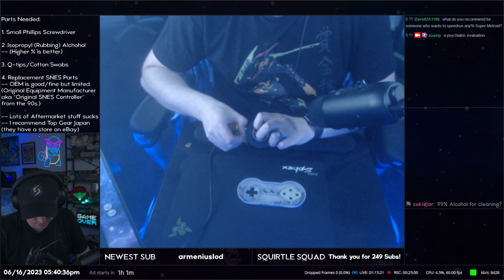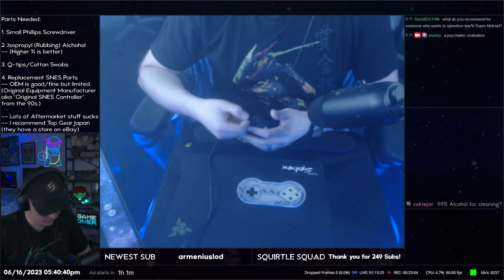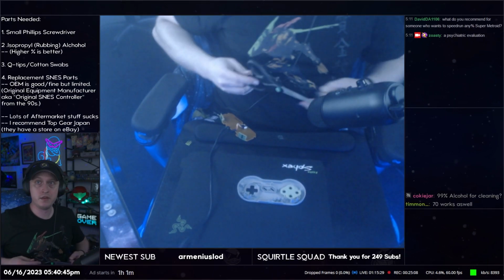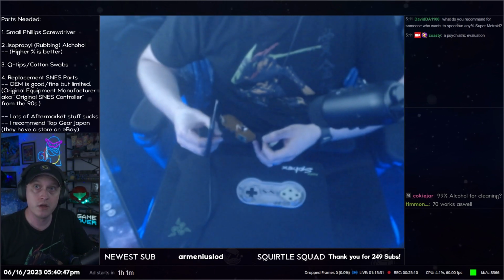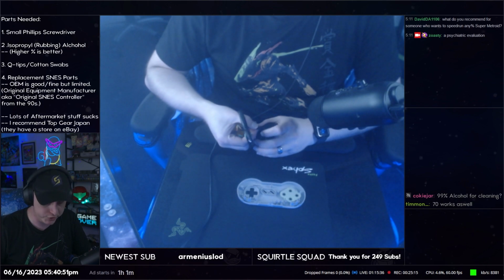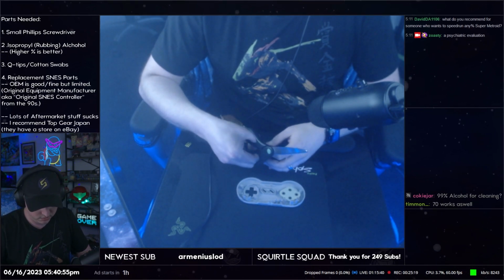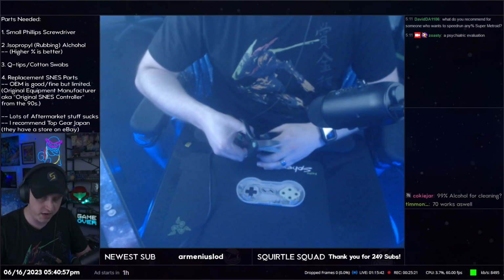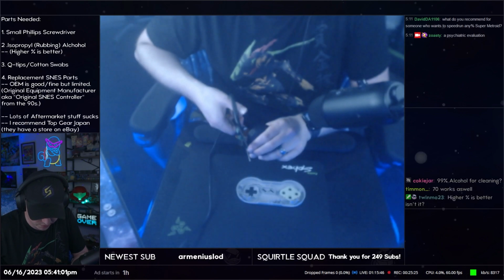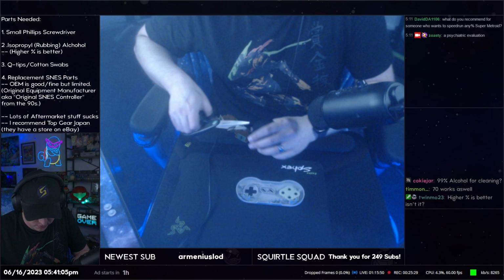Peel it off here. There's another part that I should probably edit out of the YouTube video. Oops, sorry. Yeah, so I use 91% rubbing alcohol, but 70 should be fine as long as you don't give the board a bath in it. The main thing is making sure that it's all evaporated and that the board is dry before you plug it back in and start using it.